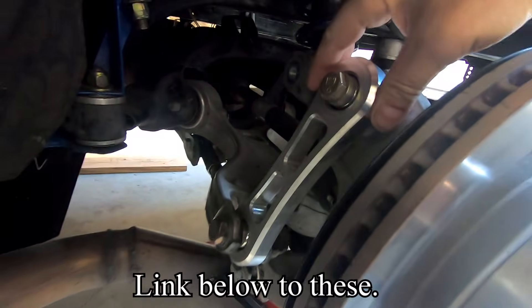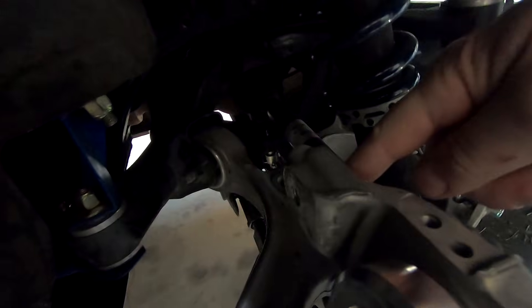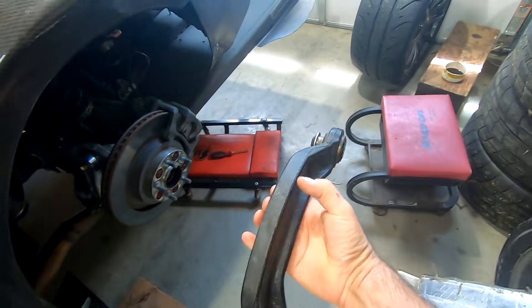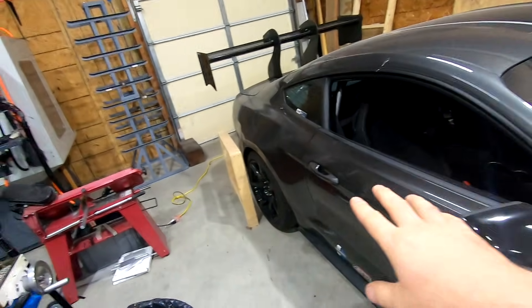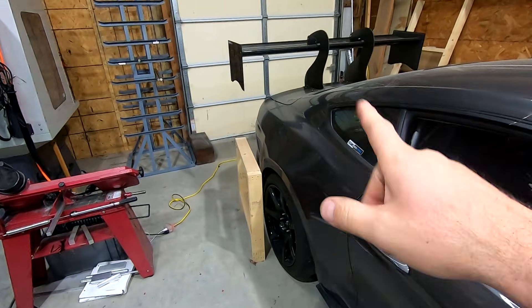Here's a set of our vertical links that we make for the S550 chassis. The camber arm is already out — it goes from that tab right there to here. Here's the OEM piece. This OEM piece is almost 5 pounds — this thing's pretty stout. The amount of curve in it is because on a normal S550, the subframe kind of sits much more tucked into the chassis.